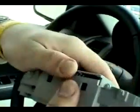From there you're going to want to pop out the base assembly out of the overhead module, insert your small screwdriver to where the tab locations are, and pop out the interior light switch.